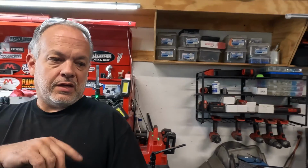And since it is a twin turbo kit, if I didn't mention that before, it is a twin turbo setup. We put V-bands on the collectors so that the piece that goes from the collector to the turbo doesn't have to come out with the header, if that makes any sense. Because right now you can get the headers in and out of the car without that, but if they were any longer, I doubt you could. So let's get the fixed, changed, modified headers on the car and start on the fun part.